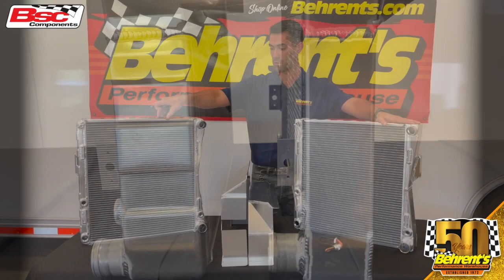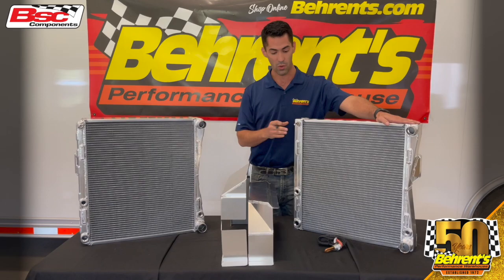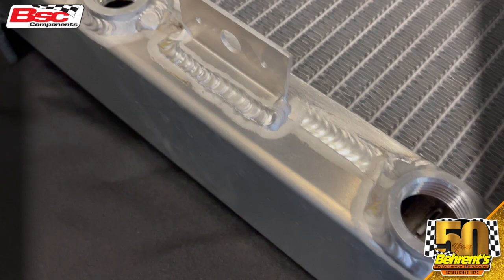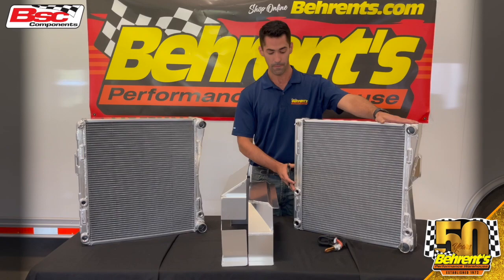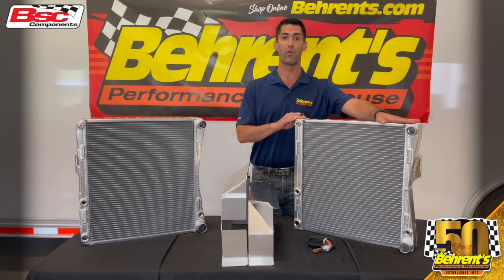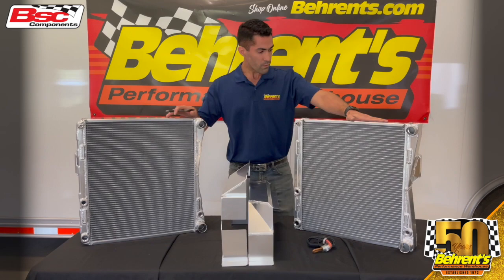So the core itself is about a half inch smaller, but as far as our inlet, outlet, and ports, they're all the same. Your quarter-inch MPT is still going to be used for your expansion tank. Your two half-inch MPT outlets are going to be used for things like water pressure, as well as some guys even putting their water temperature sending unit in there, as well as the addition of a three-quarter-inch outlet used for things like a core heater to help preheat our fluid before our race car engine is operating.